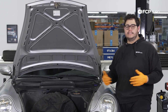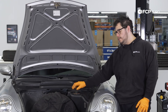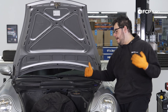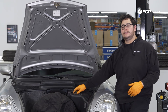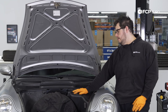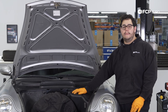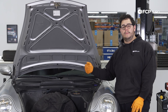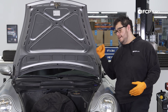That concludes the brake flush on this Carrera 911. A couple things to note: our brake system was fully closed before we did this job, so we were flushing the system rather than removing air. If your car has been sitting with its brake system apart, you likely introduced air into the system and possibly the ABS pump. To address that, you'll need to actuate the ABS pump when bleeding, and if your car has PSM, you'll need Porsche's PST2 tool to actuate the valves in that pump. Before hitting the road, pump the pedals until they get hard — if the pistons were retracted they need to return to place, otherwise you won't be able to stop.